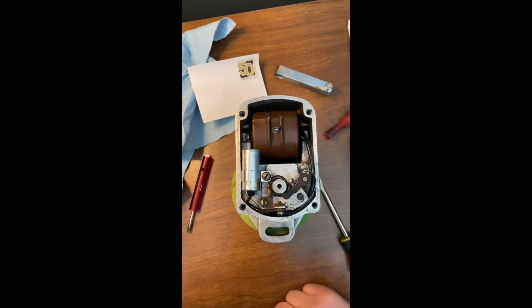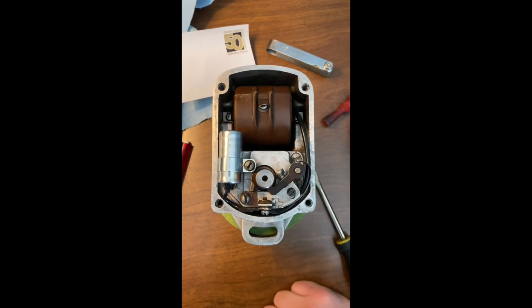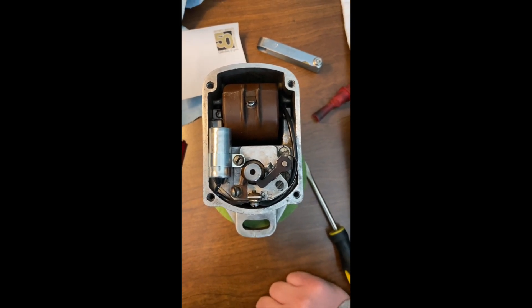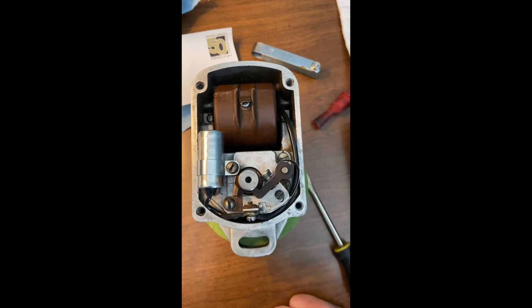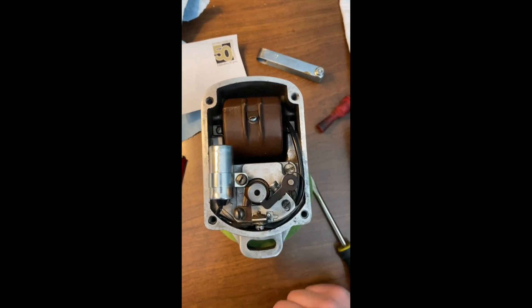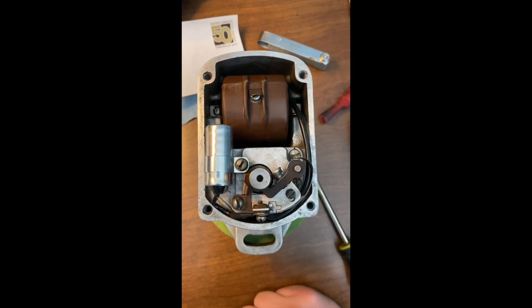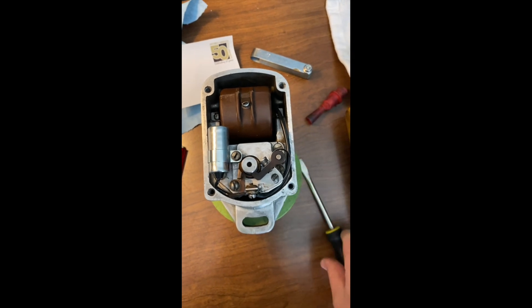This one reads about 0.32 microfarads or so, which I mean it does the job. But yeah, that's the one big thing — a lot of people look and they see the points arcing in between when they really shouldn't be, because that's the job of the condenser: to pull that arc out of there.